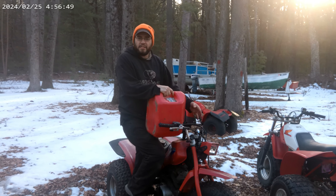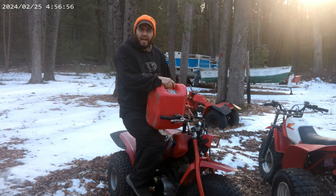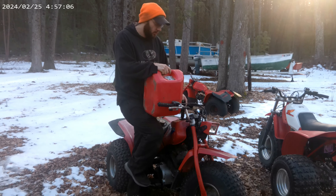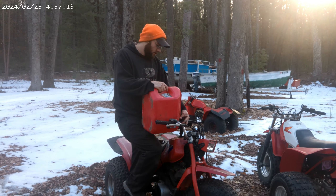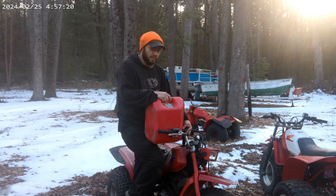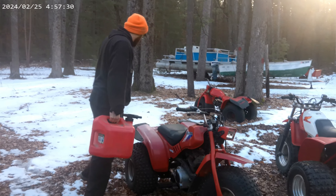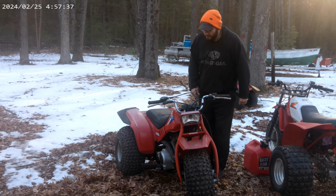Okay, so we're working outside today — I've got some paint going on in the garage. When I was last recording, it wasn't running real great; it had a hanging idle because it was running lean. It had some other carburetor issues too, probably because I had to use the Chinese parts in it. It ended up leaking all my gas out all over my garage floor. So I'm going to add some gas and then we'll see how it runs. The change I've made is that I put a bigger pilot jet in, so it should run with a little bit more gas at idle and very low throttle position. The battery unit is not any good, so we're going to have to pull start.